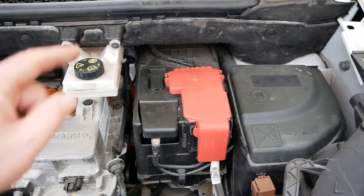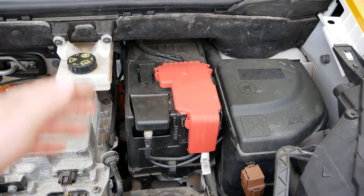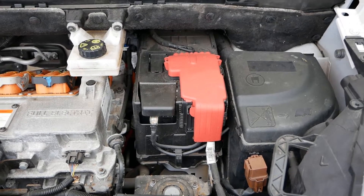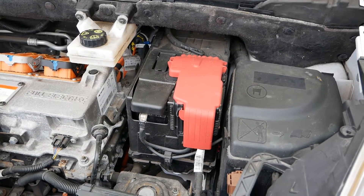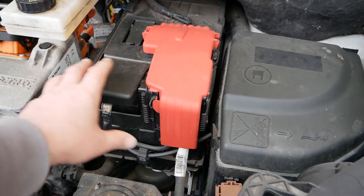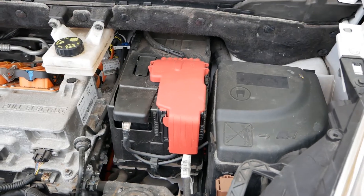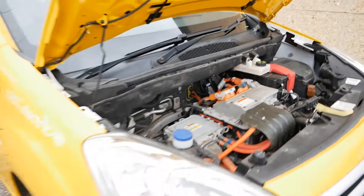Your other option is to change the 12 volt battery. It's worth noting that with lead acid batteries, if they get really flat they usually don't recover very well — so if it's gone utterly flat it's usually worth changing the battery anyway. You'll be able to charge it up but you'll always have problems with that battery from that point on. These aren't the easiest to change because they're in a plastic box with some awkward wiring, but there's another video on the channel showing how to do that.